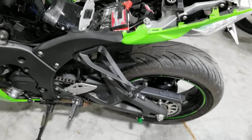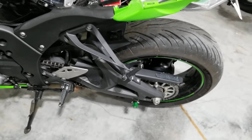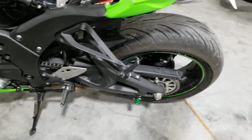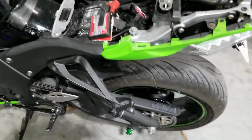On this bike, I'll be putting new tires on it, checking the brakes, and putting new chain and sprockets. So I'll probably go down 1 or up 2 in the back, just to give it that mid-range torque, because I like driving it in the mid-range.